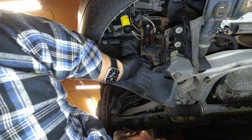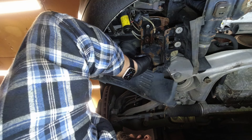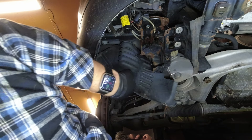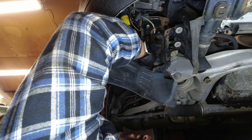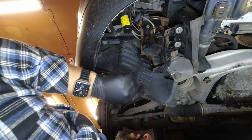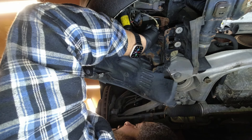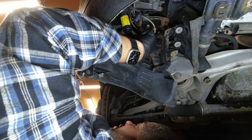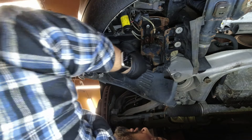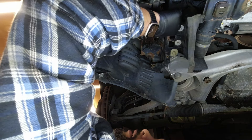That is a rusty nut and that's gonna need heat. The only way this could happen is if someone literally went in there with an impact gun and just tightened it down. These threads don't even look swollen. I think this happened when they went to put the used compressor in and they went to gun it down — and by the way, these nuts are small, like 5mm. So Gundy McGunderson, the same idiot who worked on the oil pan on my Range Rover, was in here and just took that right off. Then they had to zip-tie the compressor. Oh! That's why it was vibrating around making a racket.